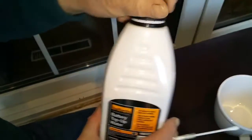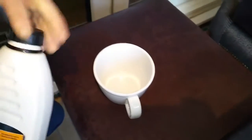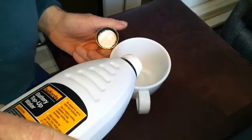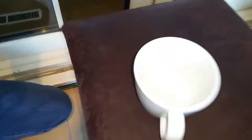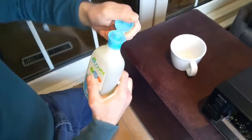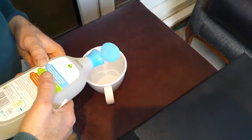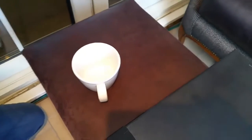Now we're going to use some battery top-up fluid, which is distilled water — put a couple of drops in like so. Then we're going to be adding some eco-friendly washing-up liquid. This solution is only being used to clean the pinch rollers, because you can't really use any chemicals on the pinch rollers — you don't want anything to melt the rubber. So we've just put a tiny little bit in there and we're going to give it a stir.